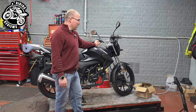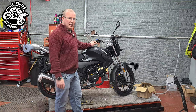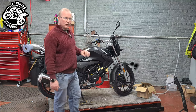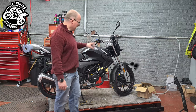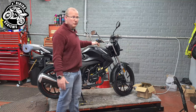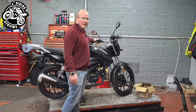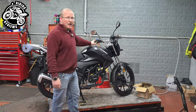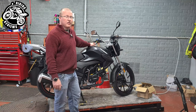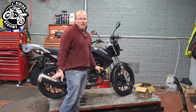That is how you adjust your clutch. Reasons for doing this: if you're finding it hard to get into neutral, that usually means the clutch hasn't got enough bite and you need to adjust it. Also, if you pull in your clutch and your bike cuts out while you're riding, it usually means the clutch isn't correctly adjusted. Usually you can adjust it on the cable itself, and then when you take it in for a service just ask them to adjust it on the engine.